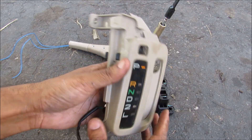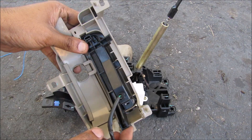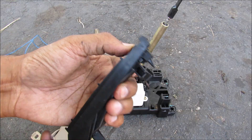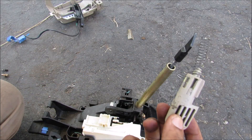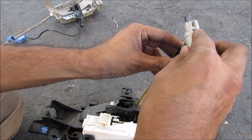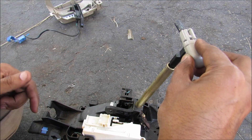This is a position indicator — it's basically a little slider inside of here that moves with the shifter. If I remove the light bar over here you can see we've got the shift lock release button, which pushes down on this button over here. Inside the shift lever button we've got this little spring, and what that does is it rides up against this triangle here. As you push it in it will actually push the triangle down, which will push the rod down to release the mechanism on the inside.